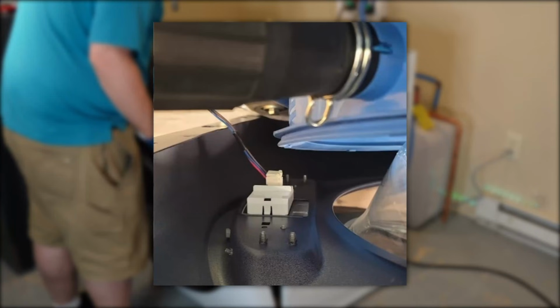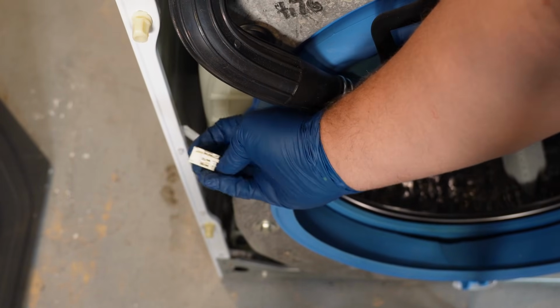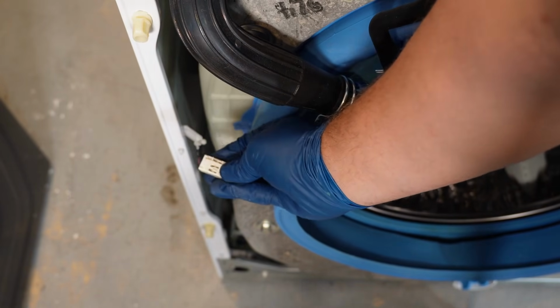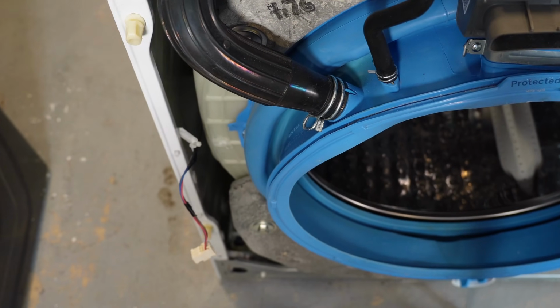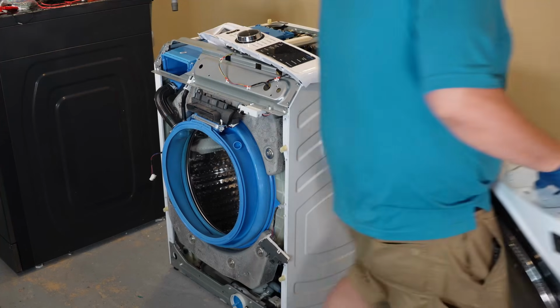As a note, that door harness can often have a bent, broken, or snapped wire that could have caused weird door lock issues that would possibly result in that main board failure, and you should inspect the wires on both the door lock on the right side as well as the wires on the left side where you could swap the door orientation if needed.